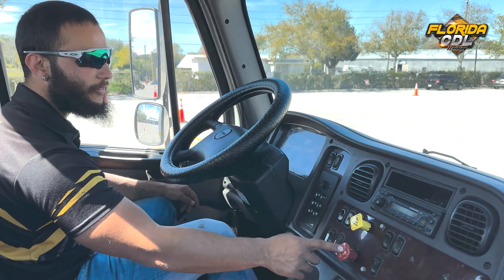That covers the cabin and brake test portion. We did the parking and trailer brake check, service brake check, and the air brake check. Now we're going to move on to the lighting indicators or checking the lights on the inside. We'll start with the ABS and DEF lights — they went on and off, which means they're working properly. Then the left turn signal, right turn signal, working properly. The four-way flashers are working properly. Then we have the low beams, working properly, and the high beams, working properly.